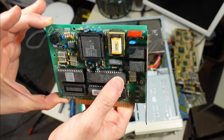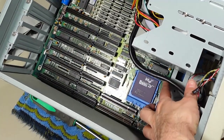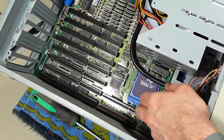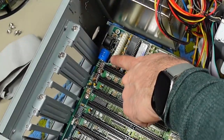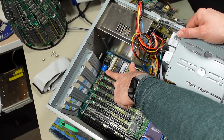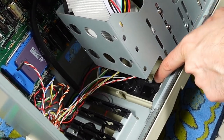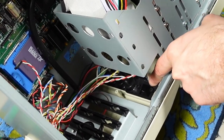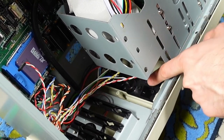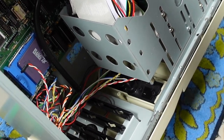If I lift this up, you'll see there are two VESA local bus slots. There is the 486DX processor — 486DX — in a ZIF socket. And it does have a NiCAD battery right here, and luckily just like in the Leading Edge, it does not appear to have leaked — that's incredible! I do want to mention that the numeric display in the case is not installed. It would be sitting right there — there are two little standoffs. Unfortunately, we won't be seeing the cool numeric display on this thing.